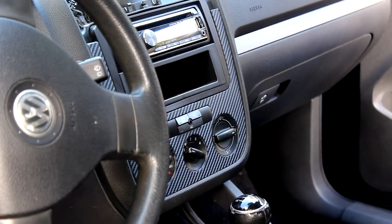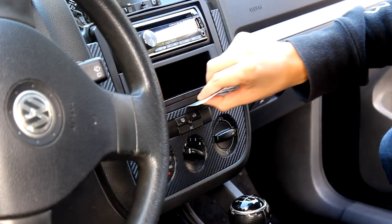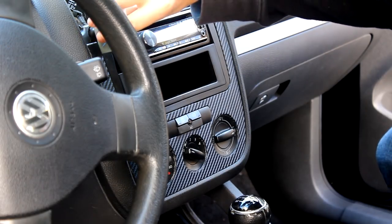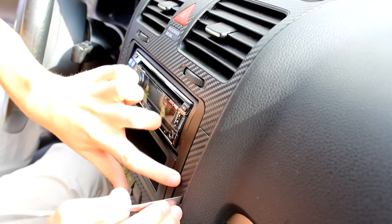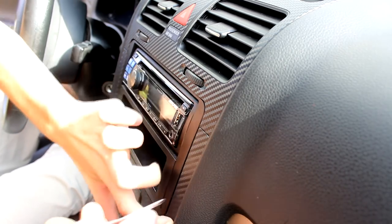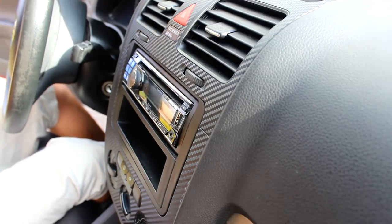Then install the pieces back into your car. The final step is to tuck the vinyl behind the trim pieces to give it a clean, finished look. To do this, slide a credit card or business card in the slot between the interior trim piece and the rest of the car. Also fix any bubbles in the vinyl. Tucking in the vinyl is the final step to wrapping interior pieces of your car. Here are some shots of my interior with the vinyl wrap.